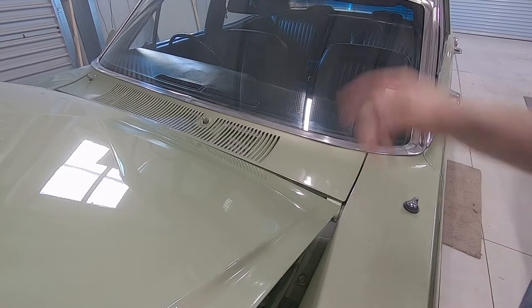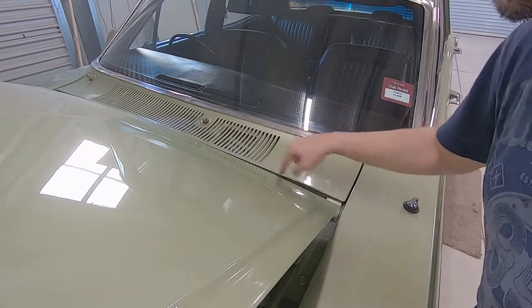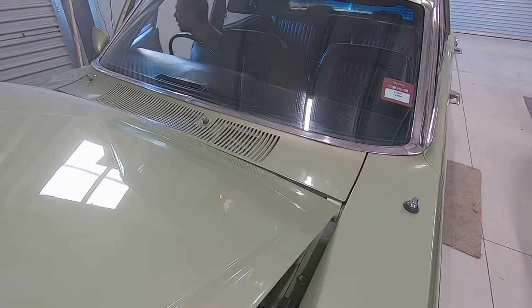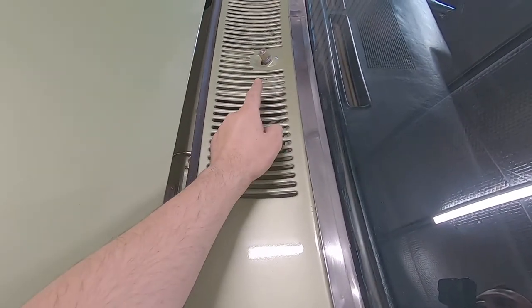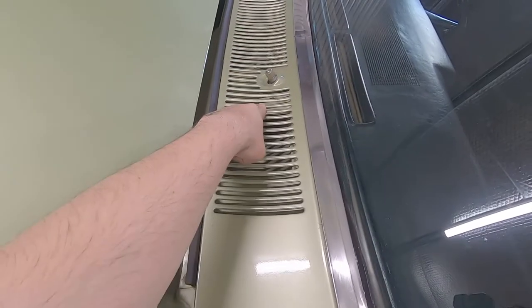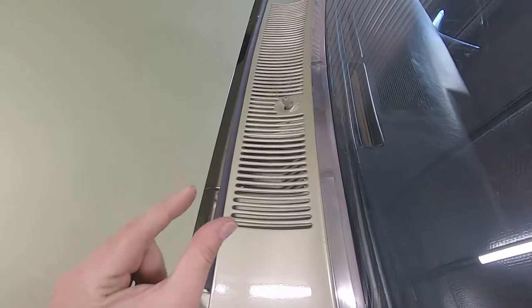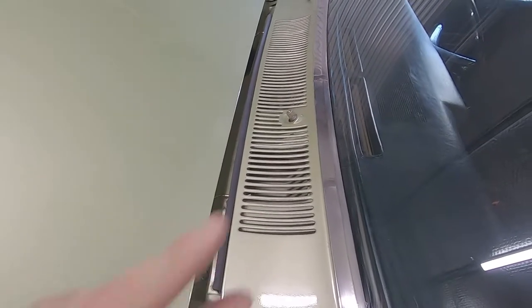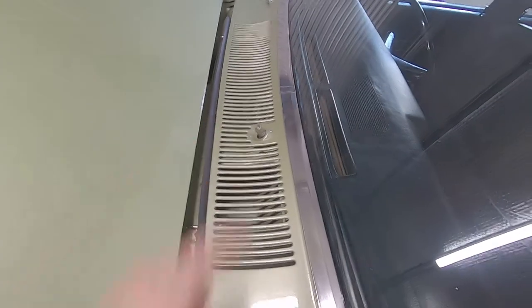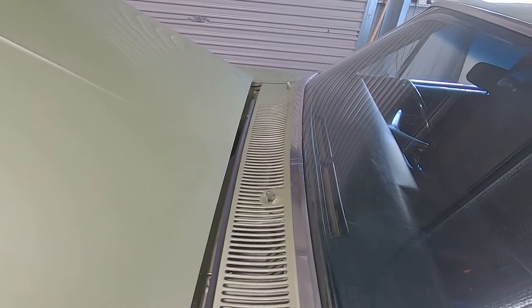Before we put the wipers back on I just want to run the whole thing to make sure it's all connected and nothing falls off — really should have done this before I screwed it all back together. Looks pretty good. The guy also said make sure your wiper motor is in good condition before you do this, because the bearings and seals in this assembly are much tighter than what was there and it's going to put strain on your wiper motor. So if your wiper motor is on its way out, maybe test it before you do this so you don't burn the thing out. But I'm really happy with that — it looks really good.